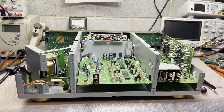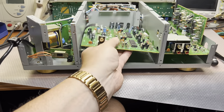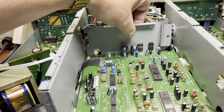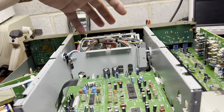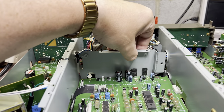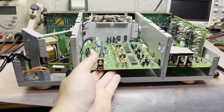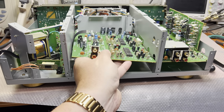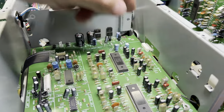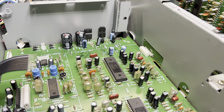After all that fun I was able to remove the back panel and release the boards. This part is not removable just by unscrewing from the bottom — it still didn't release. It probably requires disassembling from the front panel, removing the tape transport again, then removing this part. Wow, over-engineered! Let me see if I have enough room now — no, I need to pull this board up and remove this connector.